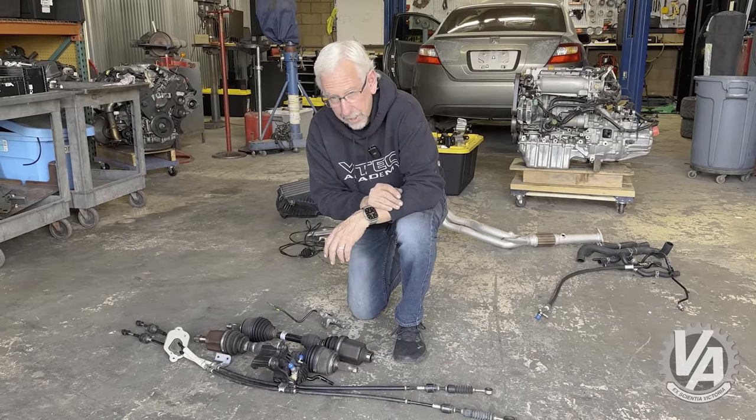Next are the shift cables. These are 06 Civic SI shift cables — they go right in the car. This matches up with the underside of the car perfectly; these brackets bolt into places that are already there and the cables work with the stock shifter. This particular shifter is from the SI — it's got a shorter rod on it, which actually acts like a short shifter, so I went ahead and upgraded to that. But if you have a manual car, you don't even have to buy this part of the shifter. You can use the stock shifter; it works absolutely fine, just with a slightly longer throw.